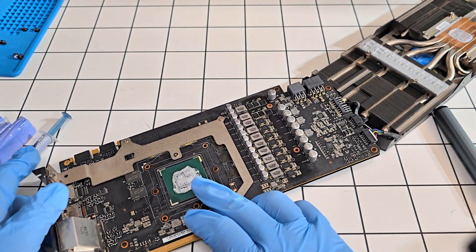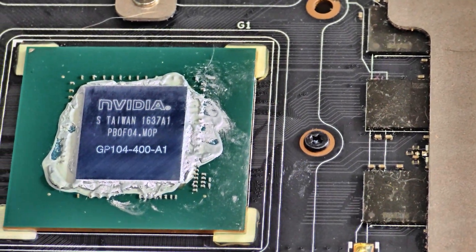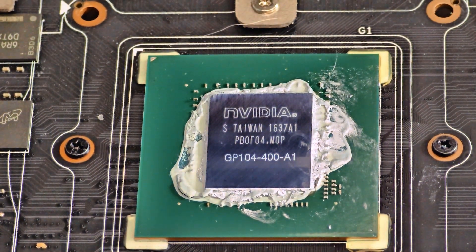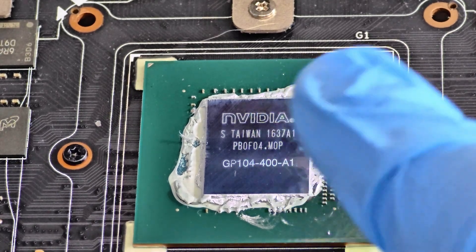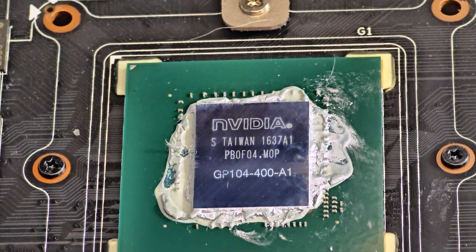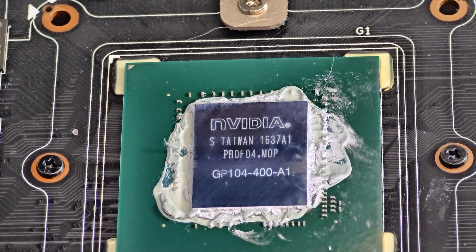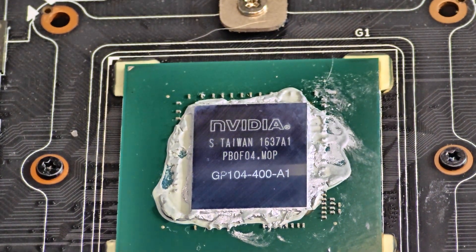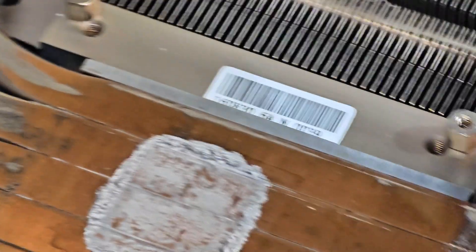All I'm going to do is clean this up and put in some brand new thermal paste. You can see there is thermal paste around the chip, but I never clean that area anymore. I had an RX 570 AMD GPU and I was cleaning the thermal paste around the chip near these little capacitors, and one of them broke off — that was like four years ago. So after that happened I just leave it like that; that's why I didn't clean it.